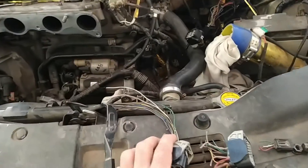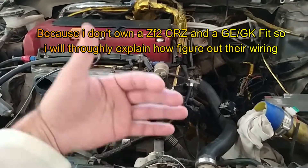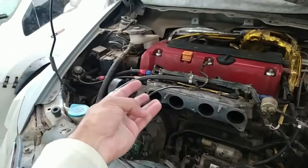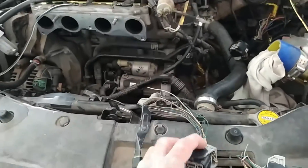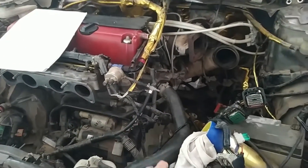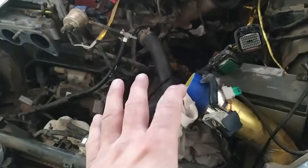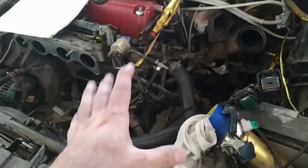I have noted that there is a lot of variation in wiring between the CRZ ZF1 and ZF2, similarly between the CRZ 2013/14 model and onward, and similarly between the Honda Fit 2nd gen and 3rd gen - the GE and GK1/GK5, etc. So I will be showing a general method of how to approach this wiring. Before you start, you need to understand the concept because you will not find a wiring diagram of the C101 or C124 connector online. I have searched and not found - trust me. You have to understand this episode, otherwise the wiring will be very difficult.